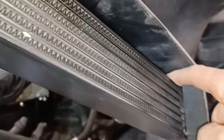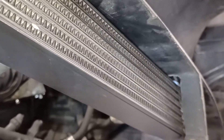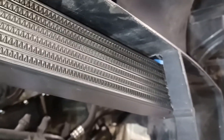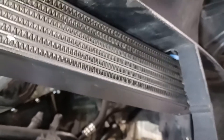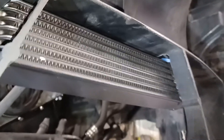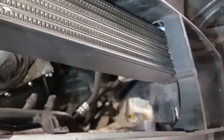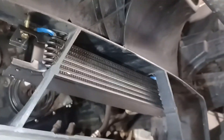I don't know how far forward you're supposed to bring the oil cooler, but it's limited by these pieces here. You can see I've trimmed these back and trimmed down here to bring the oil cooler further forward. I could have cut more out, which may have avoided the curve at the back, but I think I can cope with that using a rubber grommet or something to accommodate the curve.